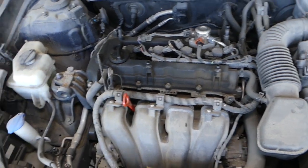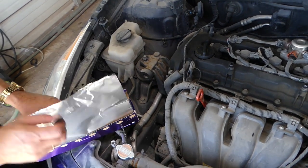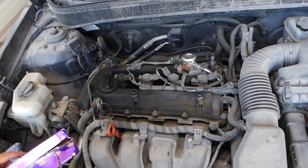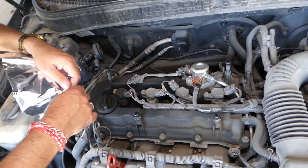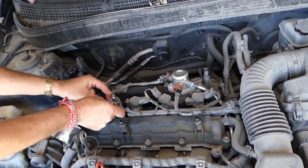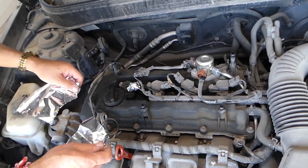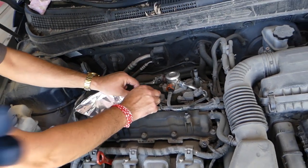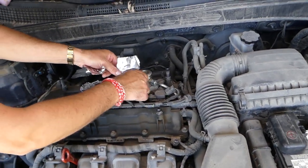So what do we do now? We need to get some aluminum foil — just regular aluminum foil for cooking. We'll use a small amount to cover connectors so we don't get them wet, which lowers the chance of something not performing right. There is always a chance of getting your ignition coils and spark plugs wet when you clean your engine. With aluminum foil, we're going to wrap the ignition coils and the wiring harness so that water cannot get into the wires. We use foil because it's super easy to wrap around things — you can use plastic wrap as well.